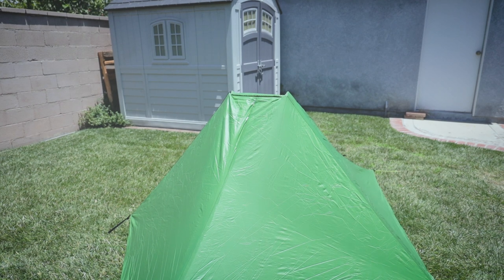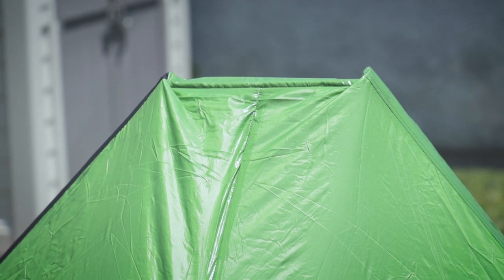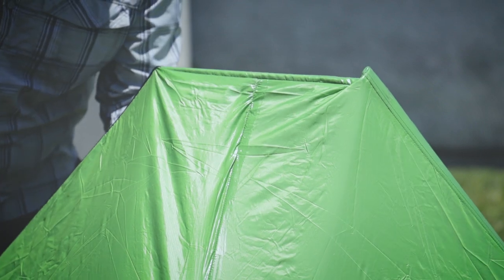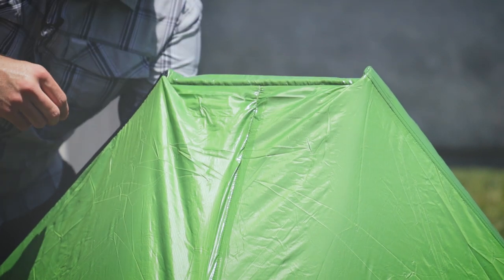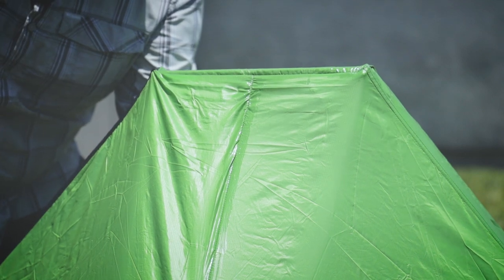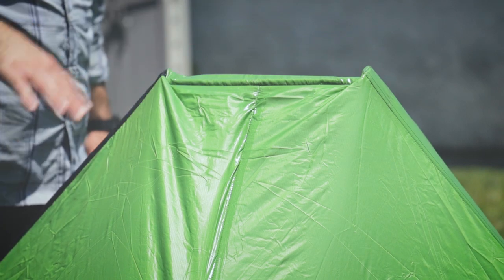What I'm going to do is open the door and press that seam up from inside. Unfortunately, the most important part of this entire process didn't get recorded, but I'll go ahead and try to recreate essentially what I did. I opened up the door over here, and because this material sits kind of weird, I actually just pressed the crossbar up and then went across with seam sealer in this area. What it allowed me to do was bring up the material where I could access all of it and make sure I got all the seams. Unfortunately the camera wasn't recording — I thought I had hit record — but that technique will allow you to get all these intricate seams up here.